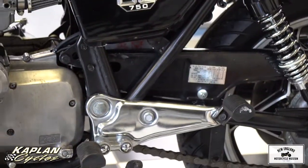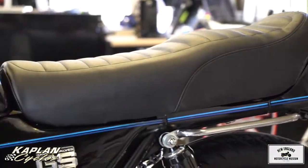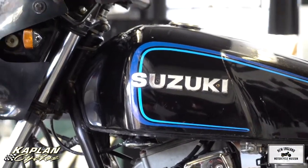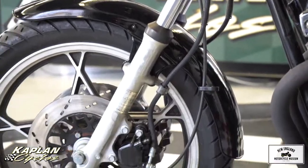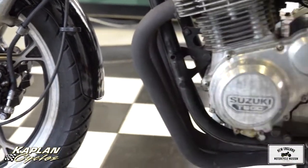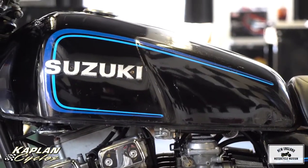We also repaired and installed correct OEM terminals and covers, routed the harness properly, and all the wires were clean and correctly routed. It has a brand new tail lamp bulb, brand new license plate bulb, brand new turn signal bulbs, and it has a custom set of carbon fiber style turn signals, which are a little sportier than the bulbous big stock ones. And then we confirmed proper operation of all the lights, which I just demonstrated.